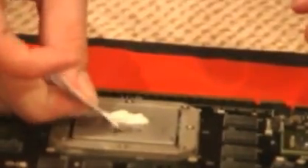Now we're going to apply the included thermal paste to the GPU. It's on there, and I'm just going to spread it around using this applicator. Now that we have finished applying the paste for the GPU, the next step is to place the thermal pads that cool the RAM chips, the PCI controller, and the voltage regulators. Those are just basically little pads that you stick on to the cooler.